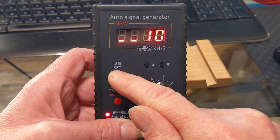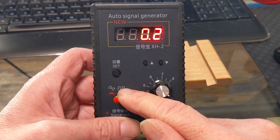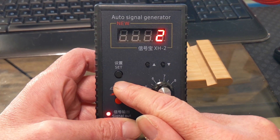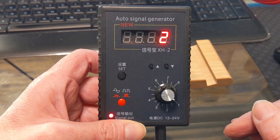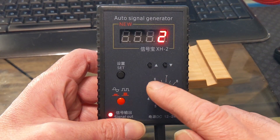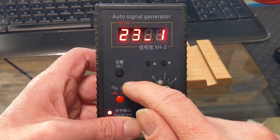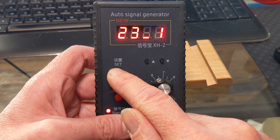There are also settings 9, 10, and 11 available, which are all simply 0 to 100 Hz. I'm currently using the 2,000 Hz output, which will give an RPM output with a crank-driven crank angle sensor of up to 10,000 Hz — that'll give me approximately 6,500 RPM, which is what I'm looking for. To select the crank angle sensor missing tooth profile, make sure the dial is turned to a frequency output greater than 2, and then press and release the set button to toggle between the missing tooth profiles you have configured.